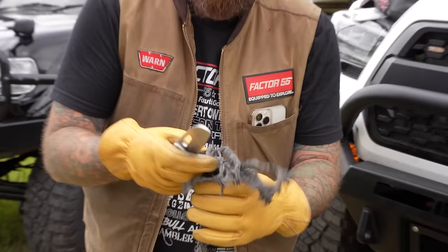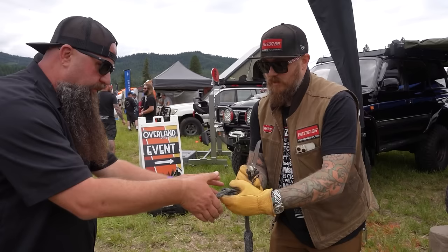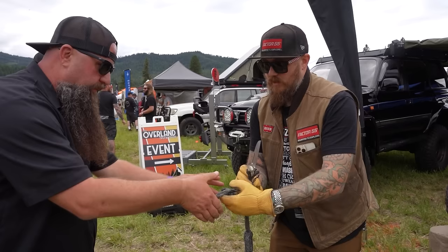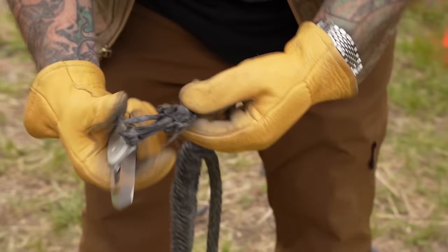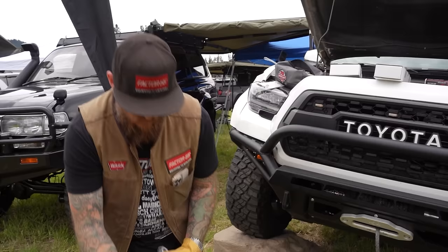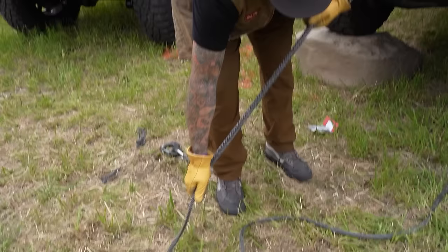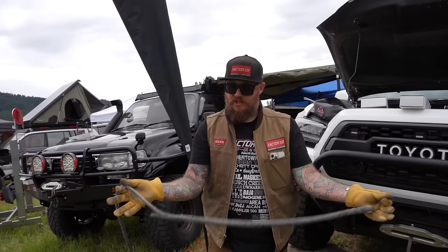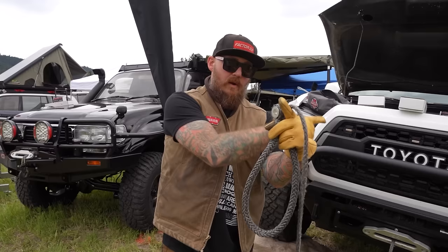You can make your own soft shackles and your own winch line extensions — it's just like any other tool. So now you can see we've got this little bit of step-down between here, giving a smoother transition to allow that to collapse down once this gets buried into itself. Then we take the end of the eye right here and literally just put it right back down inside of itself. That's just literally how simple it is to get that thing put back together. It's that easy to splice your rope. If the rope were to break in the middle, you could take the two ends, bury one tail down the center of the other, and put the line back together.